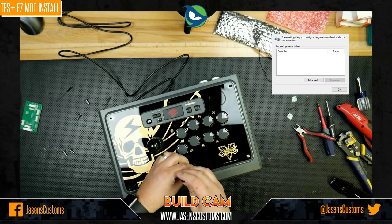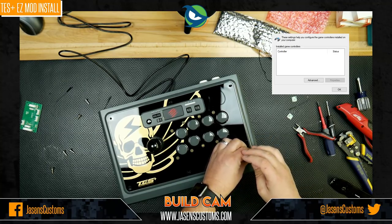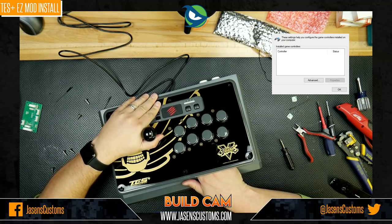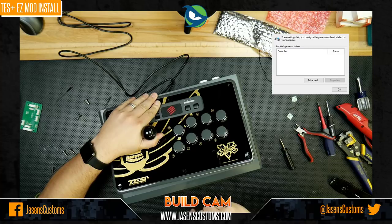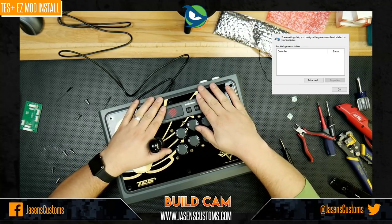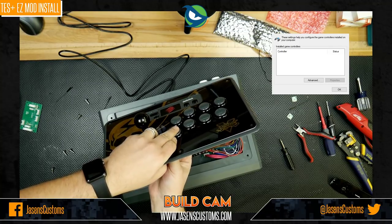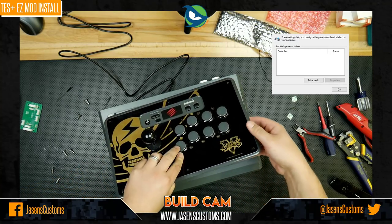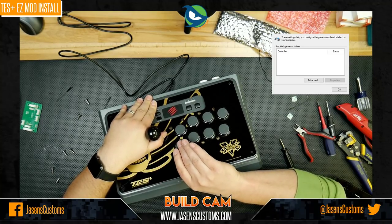And it's good that we're all seeing these at the same time together, because that means when you guys have questions and you're like, hey, this button gets stuck, what do you do to fix it? We're going to fix it together right now. All right, so I'm going to lift this back up. So what's happening is the wires for the easy build are just pressing up against the micro switch, and it's holding it down. That's what's causing it. So what we can do is rotate the button. That won't work like that. And we can bend those tabs just a little bit more. And hopefully that's enough. Nope, still not enough. It's just trying to push the button out of its spot.